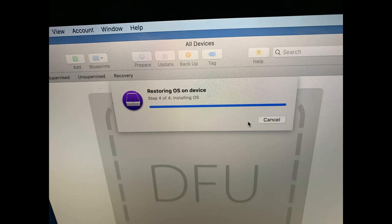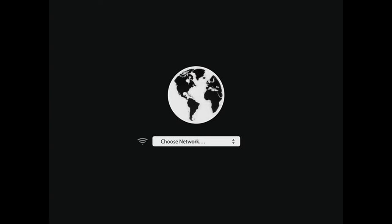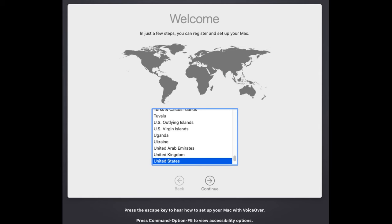After a while, the second machine will generally give you an error. It's quite a buggy process, and I haven't seen it ever announce that it's been successful. But it always seems right around this point that the locked machine wakes up, prompts you to log into the Internet, after which it reinstalls the OS. Be patient, because it can take an hour or so to pull down the OS from the Internet — it's doing an Internet restore. But once it's done, you'll have a fully recovered machine. Just make sure to remember the password you set so you don't have to do the whole thing all over again.